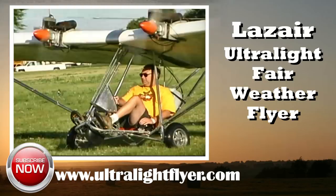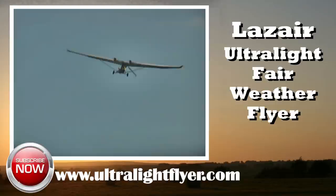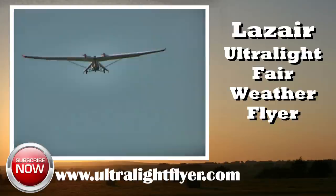The Lazair Series 2 and Series 3 ultralights made great float planes and could be found throughout cottage country in Ontario. Climb rate on the Lazair Series 2 and 3 ultralights is approximately 450 to 500 feet per minute. Cruise comes in at between 35 and 45 miles per hour. Stall is around 25 miles per hour.